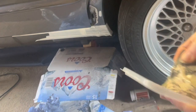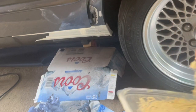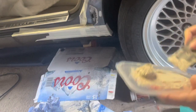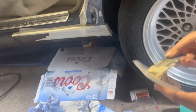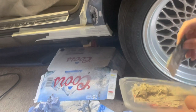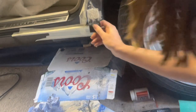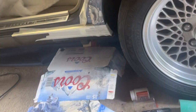Of course, adding the fiberglass makes this just a little bit thicker. Ideally I should be wearing some gloves. I'm going to open the door to avoid getting filler all over the rest of the car. I've added some tape just to define a boundary — I really don't want to go any further than that with the paint, trying to keep the repair area as small as possible. I've cleaned this down with some white spirit first to make sure the surface is as clean as possible. I'll try and shove the filler in there — at this stage it will look pretty rough because I'm really just trying to fill that hole.